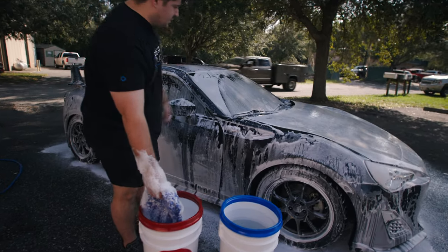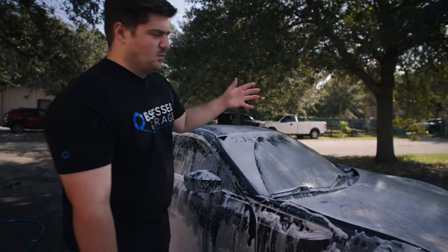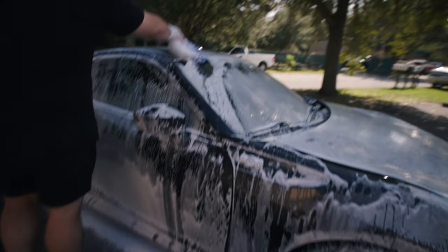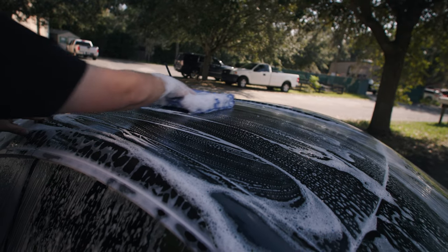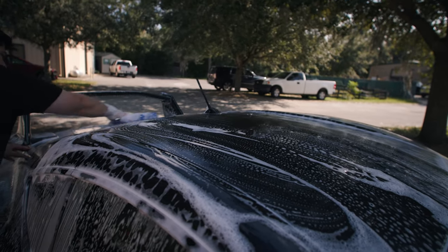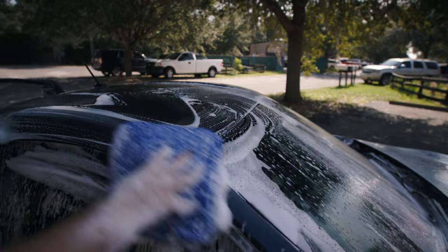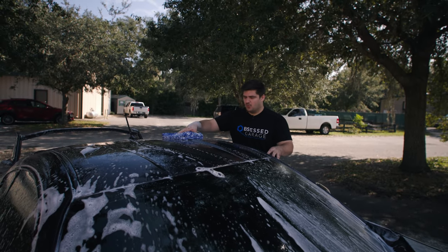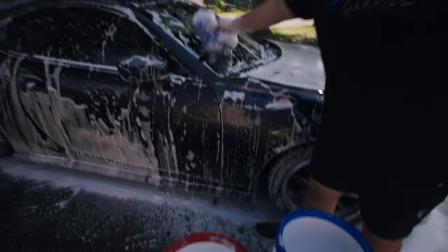From here it's pretty simple — wash the car starting from top down, going panel by panel. Use your judgment: start with the least dirty sections and work your way down to the most dirty sections. Apply soap to the pad and start with the roof. Move in straight directions — north-south, east-west — no circles, because that's how we induce swirls. I'm not pushing into the pad or scrubbing; I'm basically just holding it on the surface. Don't push hard, but don't use just your fingertips either. Rinse, get some more soap, and do the front glass.